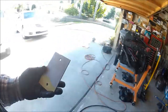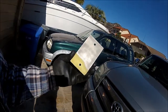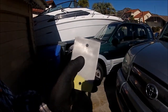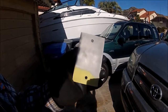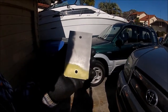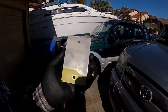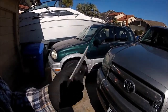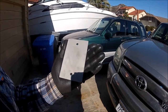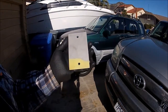Here's a piece of steel that I did just this morning to test it out. It had some zinc chromic primer on it. If you look at that, it's a really, really nice finish — kind of a matte finish. It's not perfectly polished and not perfectly smooth, which is good because on almost a microscopic level it creates more area for primers to adhere to. I went with 70 grit aluminum oxide on the blasting media. This is a piece of mild steel — I'll have to test it a bit more on aluminum. But I'm pretty sure it'll work. It creates a lot less dust and it's not as much of a health hazard, and it should last a lot longer.